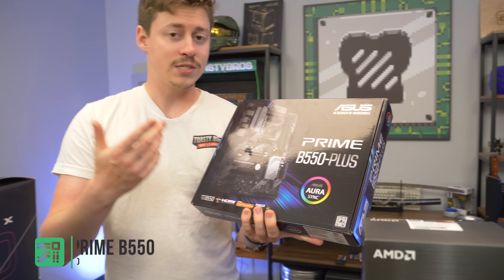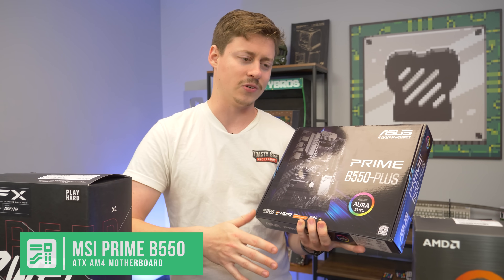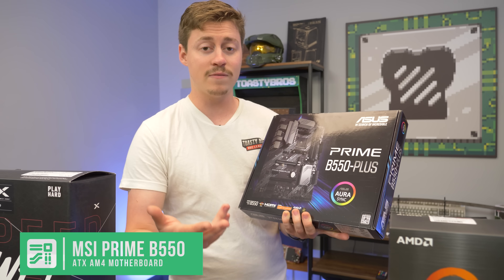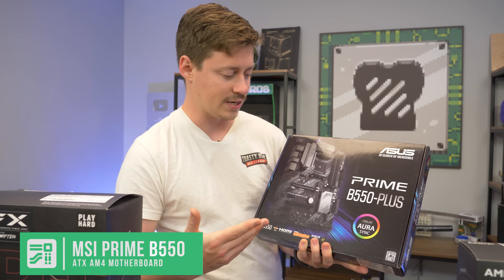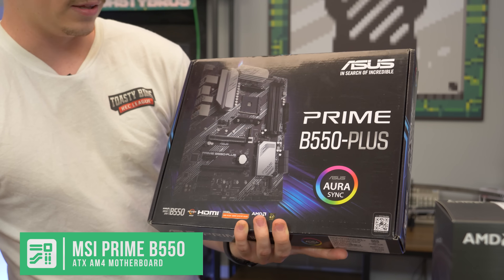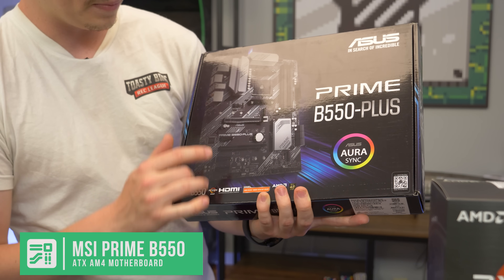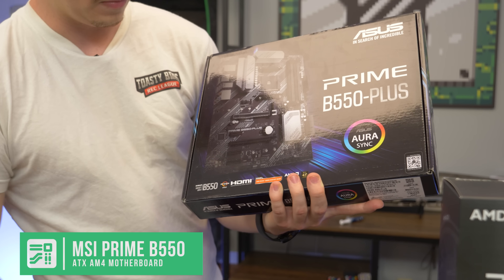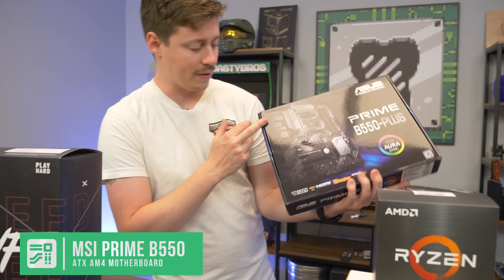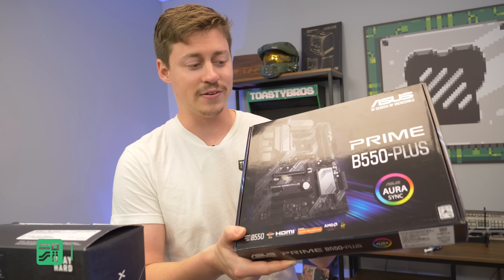For the motherboard, we went with the Asus Prime B550 Plus to ensure Gen 4 support and avoid any weird BIOS flashing — there's no reason to go with the B450. The X570 and B450 will also work. We've got four RAM slots, two 4-pin CPU connectors in case you want to upgrade to a higher-end CPU down the road, an additional NVMe slot, and lots of PCIe lanes. It's a really upgradable board with a great number of USB ports for a relatively cheap B550.